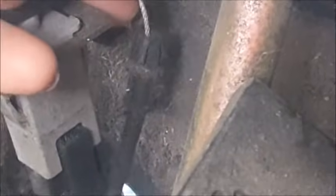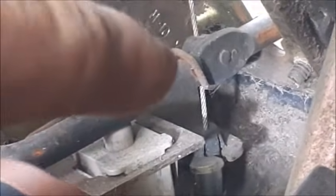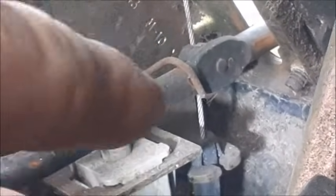Now with it dropped down, we can pull it down and get that cable to come. Now the cable can push right through that slit right there in the metal. And likewise, the little knob that goes on the plastic piece is here on the engagement lever, and it'll slide right up off the peg that's on the side of the lever.